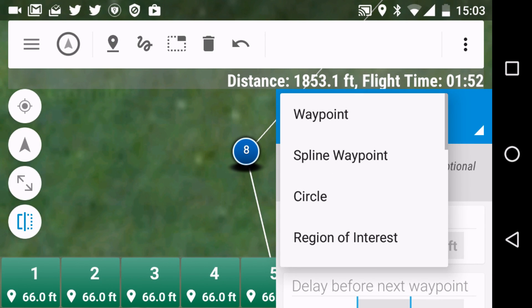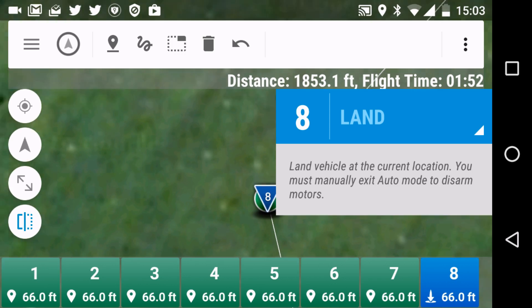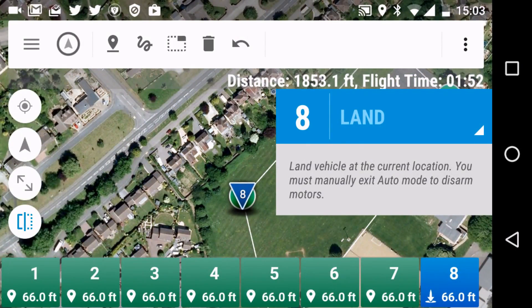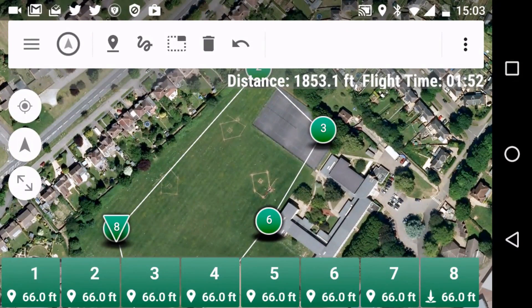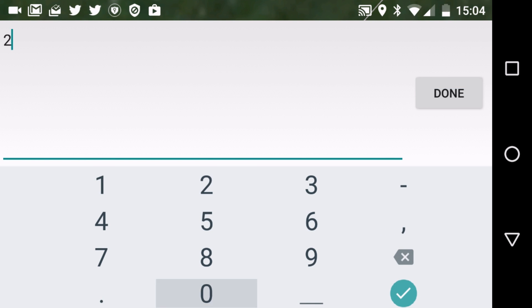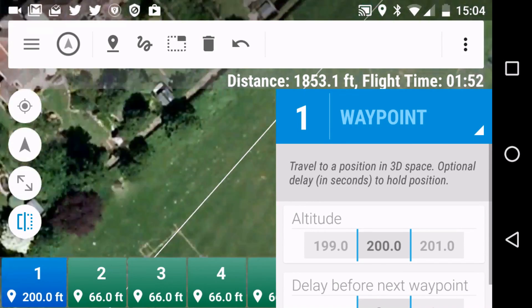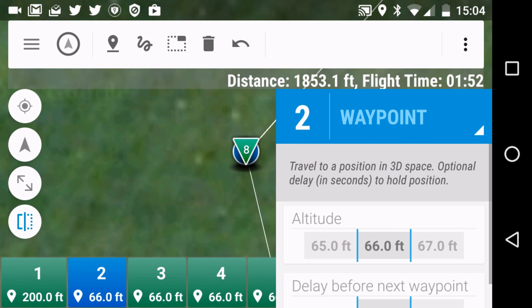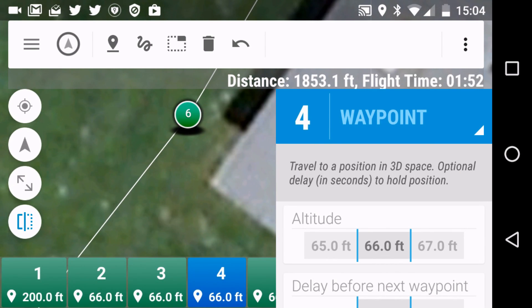You can click on each waypoint and change what it is — for the last one we'll select Land. You can set number one as Takeoff if you want, or just let it hover and then switch it into auto mode. You can literally write that wirelessly straight to the copter: click Connect and then wirelessly send it, and it will travel exactly that path all the way around. Here I'm typing in a starting altitude of 200 feet just for fun. It's a very configurable little app — you can also do clever stuff like Follow Me, where the quad tracks the GPS on your phone and follows you. You can do all the clever stuff you'd do with a DJI Phantom, but for a lot less money.